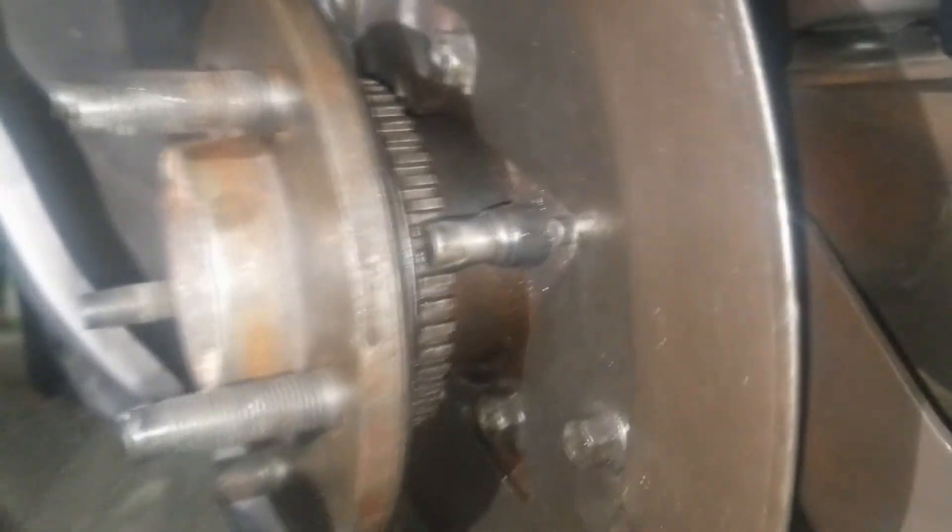So that was the grinding issue. If you have that noise coming from your rear end, you may want to check for a rear seal axle leak and check your bearings. When your car's jacked up, grab your wheel and move it — if it's moving a quarter of an inch or so with a lot of play, and it's not the brakes or suspension moving but literally a click-click-click, go ahead and pull that axle out and check if your bearing has caused a groove within that axle. That was the fix for me.